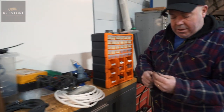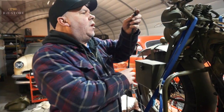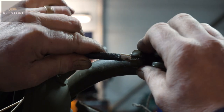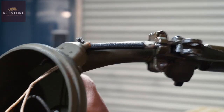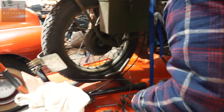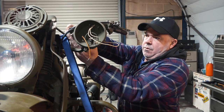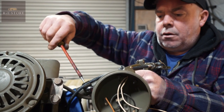I haven't got one so we'll have to take one off the other end. Make sure that bit of cable sticking out there is butted in there properly — otherwise it'll just push that ferrule down over the cloth. You've got to make sure that's butted up hard. Our cable in there — this is going to be miles too long because it's universal. Right, where's my bolt for that? It goes in there — this is the wrong nut and bolt but I just need them running right.